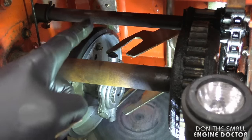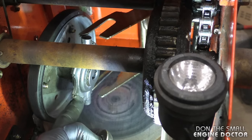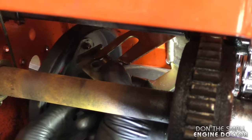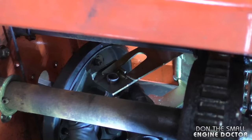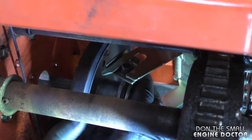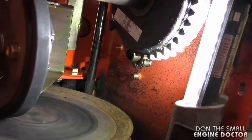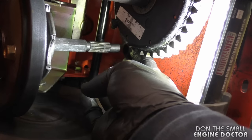This might be the tricky part to reinstall. The metal piece goes at the top here, right on this part of the friction disc assembly, and the washer goes on the bottom part of the assembly right here. So this part goes in this position right on that little shaft, and the washer goes on the bottom part of the friction disc assembly. Now slide both parts of the friction disc assembly into the forks. You can see the washers are in there properly and also the square washer on top.